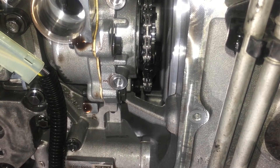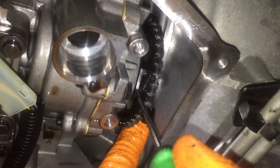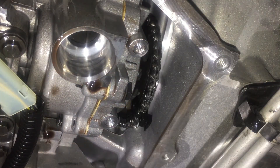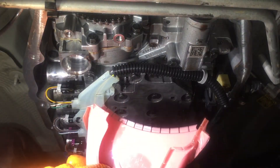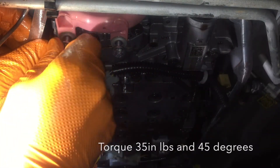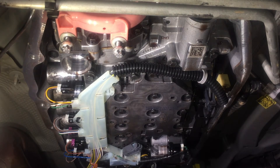Install the oil pump sprocket onto the splined oil pump, then push the clip back in and you'll see it fall into place — you shouldn't be able to push it off at this point. Clip the little zip tie you installed earlier. Put the oil pump baffle back in and install those two bolts — they are torque-to-yield. Torque the baffle bolts to 35 inch-pounds and 45 degrees.